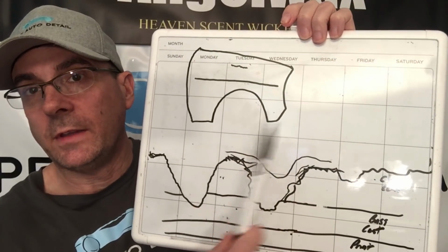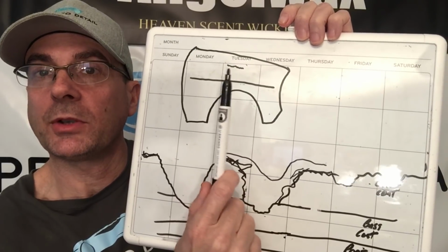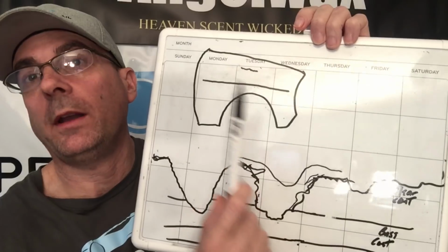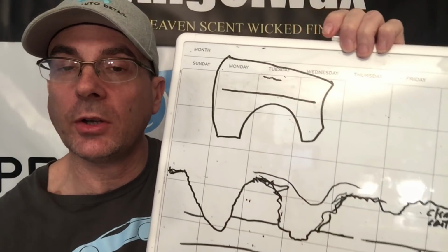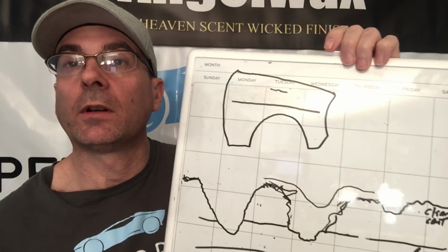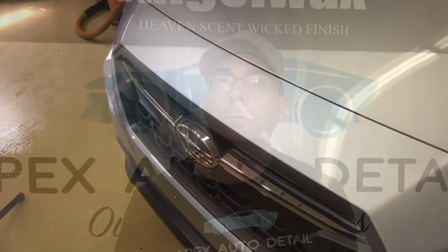This is a fender, and you have a scratch in this one area. If you're going back and forth with a DA, you're going to be raising temperature in this area in excess of 140 degrees, where the rest of the panel is room temperature. That is one heck of a lot of stress to put on the clear coat when you can do exactly what I'm going to show you in this video. Keep temperature rising to a minimum and give your clear coat a break that's already been through enough stress with this damage and scratch. So let me show you what I mean.